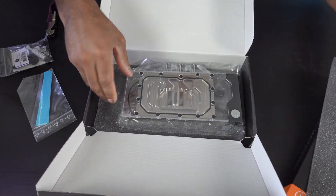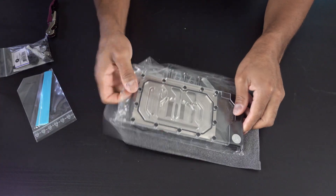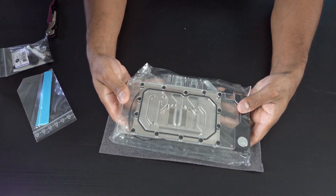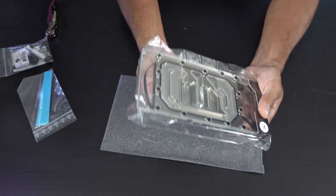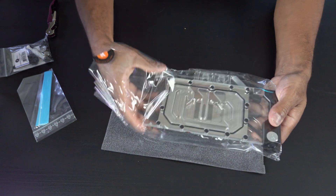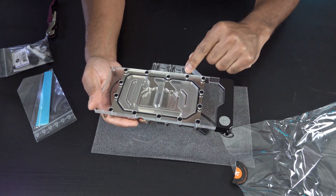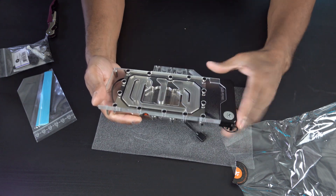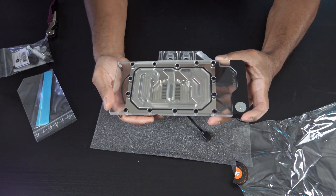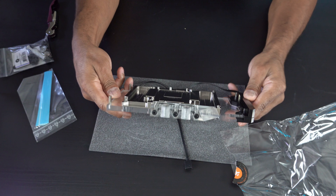And here we go — this is definitely very familiar. When it comes to any type of water cooling hardware, I always inspect it for a number of reasons. One, it's the times — we are in a time of reduced labor force in different areas because of social distancing and all that. So there can be flaws in manufacturing processes, shipping issues, all kinds of stuff. So I always look to see if there are any cracks anywhere along where things could vibrate during shipping. The jet plate right here is in the right position — take a look at my previous video where I had to fix that with another one of these water blocks. Under first inspection this looks pretty darn good.